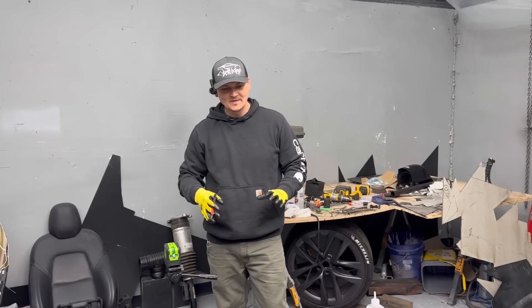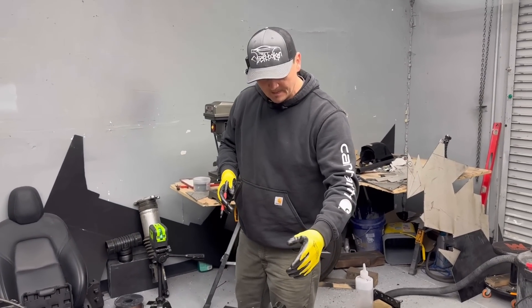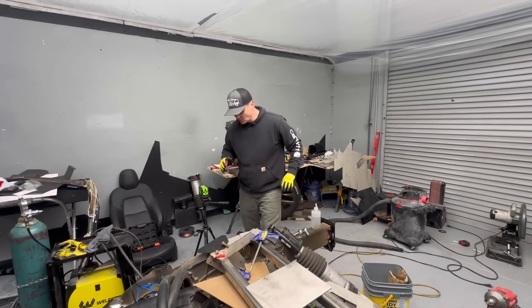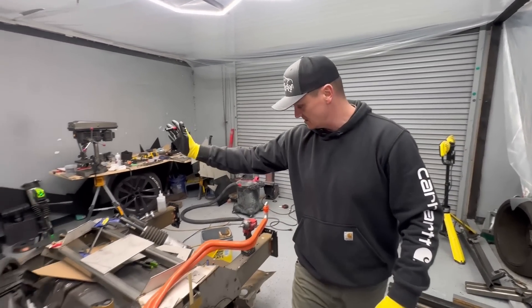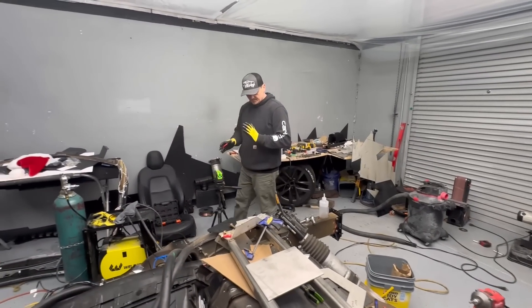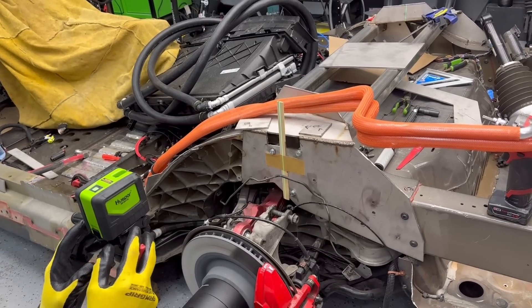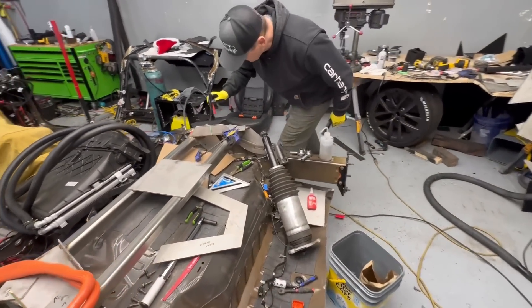Today I think I'm going to put on the cantilever and the shocks. The shocks are basically going to be butted up against each other back to back. Right now with the laser I'm making sure it's absolutely centered — my threshold is 1/30th of an inch. Cars from the factory are way off of that. On this stick is my midpoint for this side and this is my midpoint for the other side — we are absolutely centered right now.